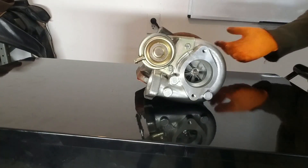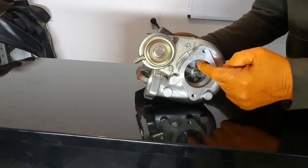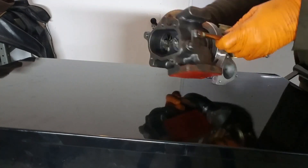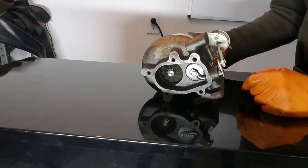This is a turbocharger from a Nissan, but the principles are basically the same. This rotating turbine pressurizes the intake air that passes through it, sending it out at high pressure. Now let's reverse it to the exhaust side — here you see the turbine that is spun up by the exhaust gases.